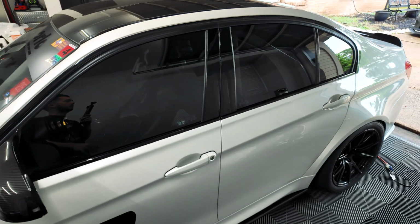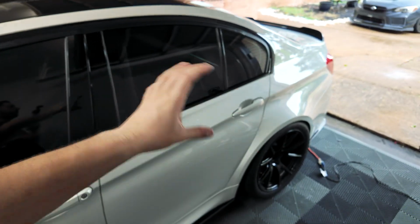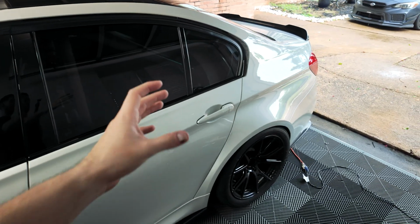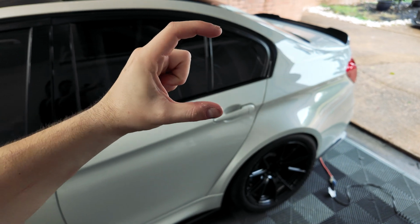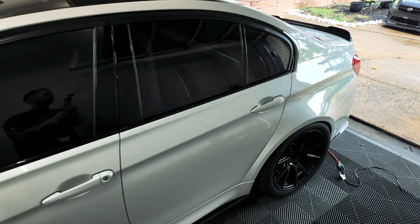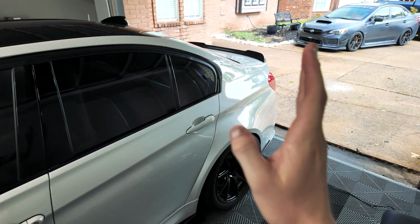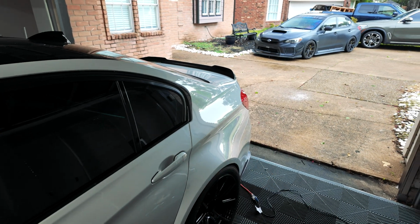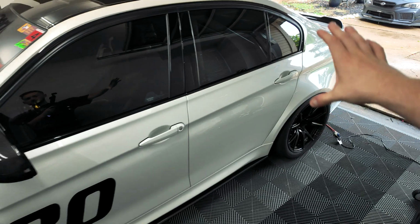We ended up getting that done, and then pressing the new ones in is even more difficult because they're solid, so they have absolutely zero play, and they like to crab walk themselves in there, where they zigzag in, and it goes in crooked, crooked, crooked. And it's a pain in the butt to try and get it perfectly straight. And with this lift kit, you need to make sure that the offset bushings are perfectly straight up and down so that they'll align to the new rear subframe mount. So it's quite a hassle in the rear.